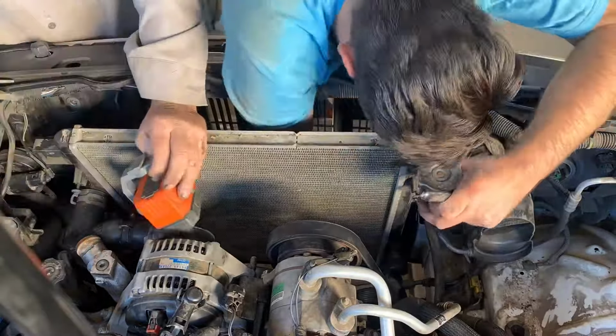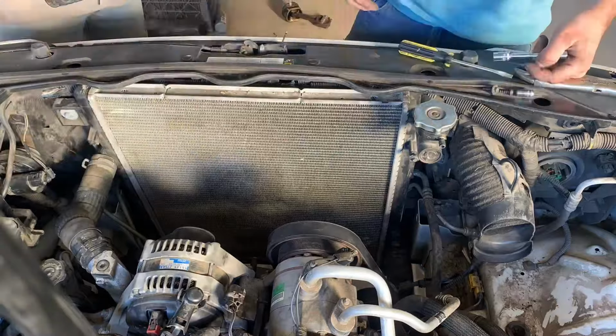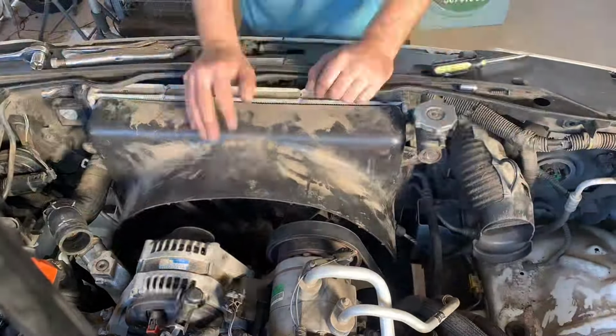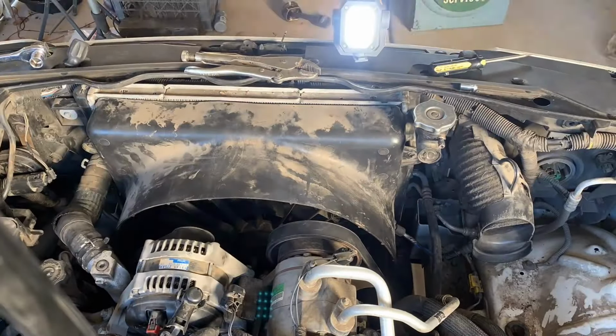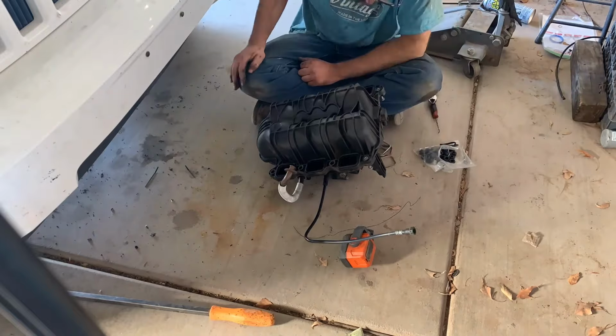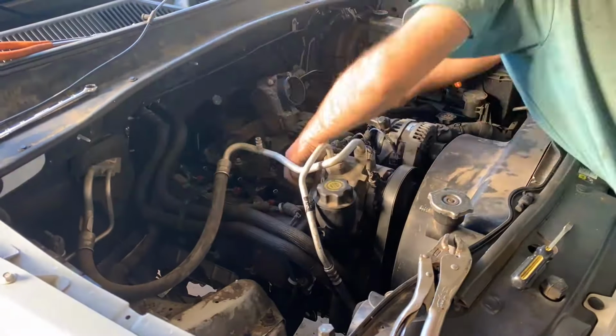One of the tricky things we had to deal with when reassembling this was the AC system / condenser that goes in front of the radiator. We didn't undo the air conditioner. We laid the compressor to the side and we did not take out the tranny cooler and the AC condenser. So it took us a while to put the radiator back in because it's bolted to all that stuff and we did not want to pierce those pieces.